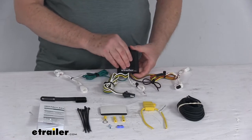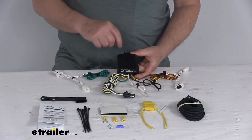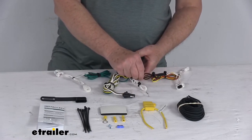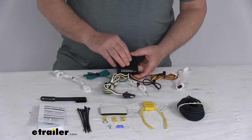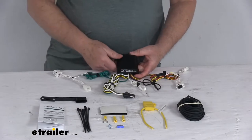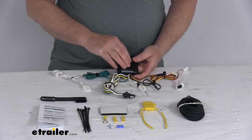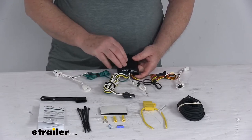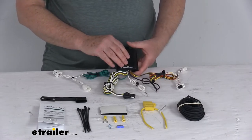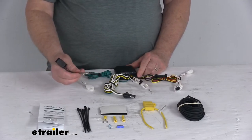It does include this black box here, which is your tail light converter. This is to ensure that your vehicle's wiring will match that of your trailer. It is a powered module, which is why it connects directly to your vehicle's battery — they do that to avoid overloading your vehicle's electrical system. This converter is constructed using SMT technology, which is surface mount technology, giving you more consistent, reliable performance. It will maximize your trailer light yield and intensity while producing minimal heat, and it also ensures superior operation in any rough road conditions.